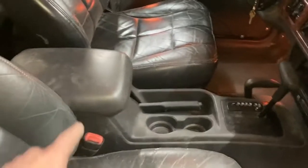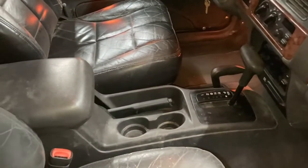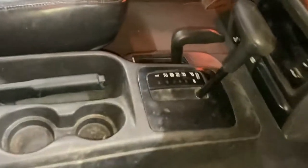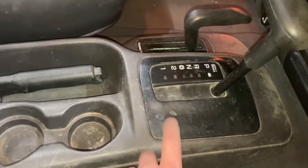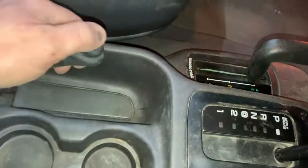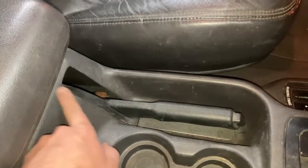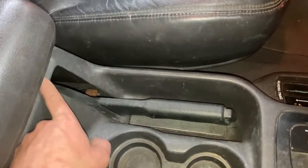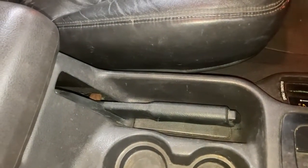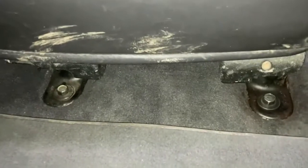For that center console, there's going to be 2 screws at the back here, right in the bottom. There's going to be underneath this plate, there's 4 screws right there that hold that down. So it's just 6 screws to hold down the center console. And then you just got to snap in your pieces back in here. There's this one, and then there's this one here that you'll have to snap back into place. And then underneath of there, there's this one. In my case, this ended up breaking in behind here. It's just kind of plastic welded, and the tabs and everything broke, so have to deal with that for now. And then, of course, for the seats, the seats are just going to have 2 bolts up front and 2 bolts in the back there.